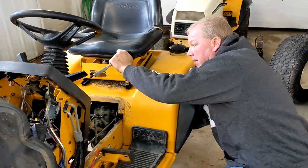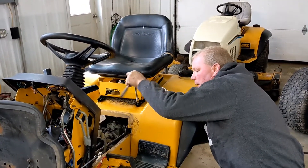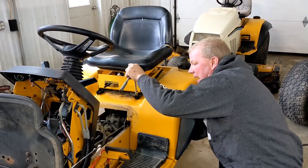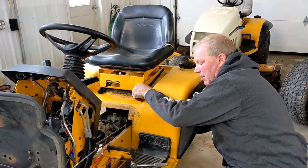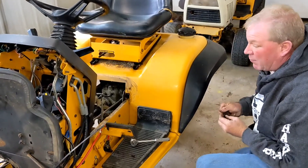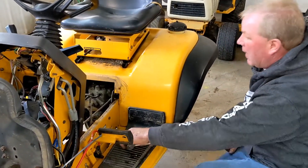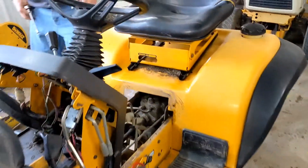I'm going to show you a trick based on a mistake I made once: when you're putting those fenders back on, you have to be really cautious. I had a machine — got it all back together, thought I had everything quite right — and I pinched the wiring harness, had a dead short. Had a little bit of heat. Not going to lie to you.